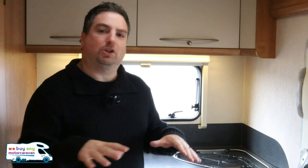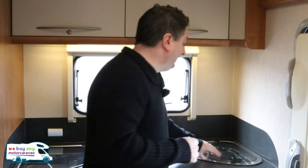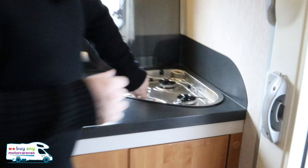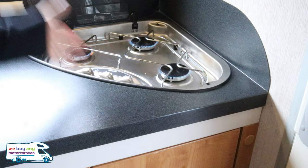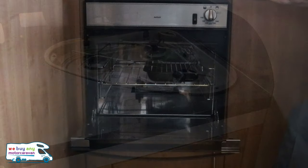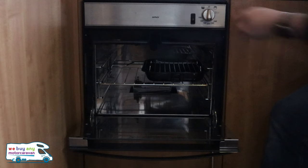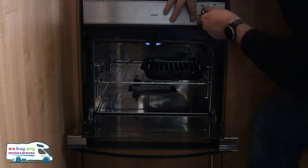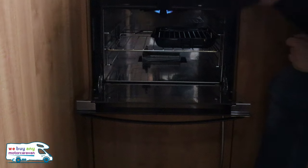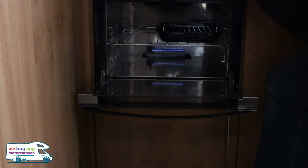One thing I always do before I go on any holiday — and it's a bit dad, I know — I come into the motorhome and I double-check that everything's working before we go, because the last thing you want is your kids saying 'Daddy, I want something to eat' and your gas doesn't work. So make sure you've got a full gas canister out the back and just make sure that each and every one of your rings keeps burning. This particular motorhome has an oven and grill running off the gas. Don't forget to take your vent off outside. The right side is for your grill — righty toasty, that's when your toast happens. The left side is your winner winner chicken dinner — that's your oven.